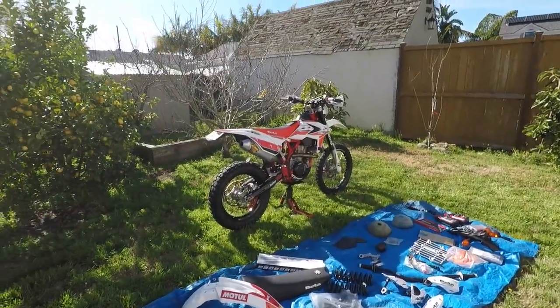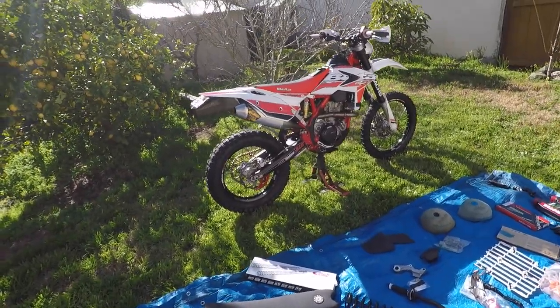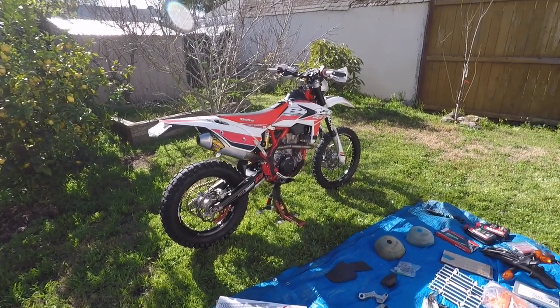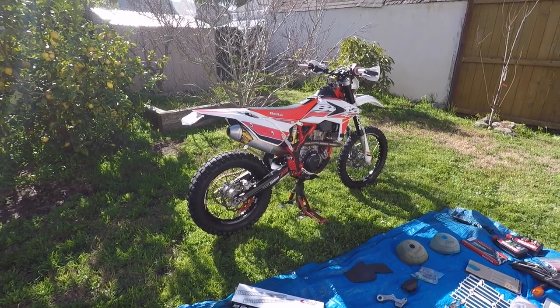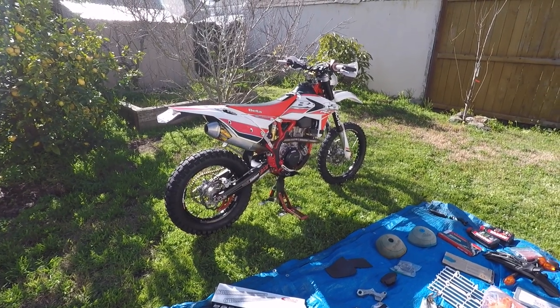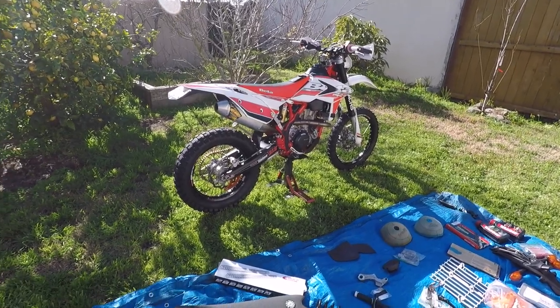So it's all set up, and like I said, it's a 2018. It's got some miles on it, but I baby it, and it's a 500, so you're never revving this thing out. Like I said, after 7,700 miles, the oil pump gears looked brand freaking new, and I change the oil religiously every 30 hours, make sure valves are in adjustment, flush coolant all the time, service the forks all the time with fresh fluid in them. I mean, it's really, really dialed. So